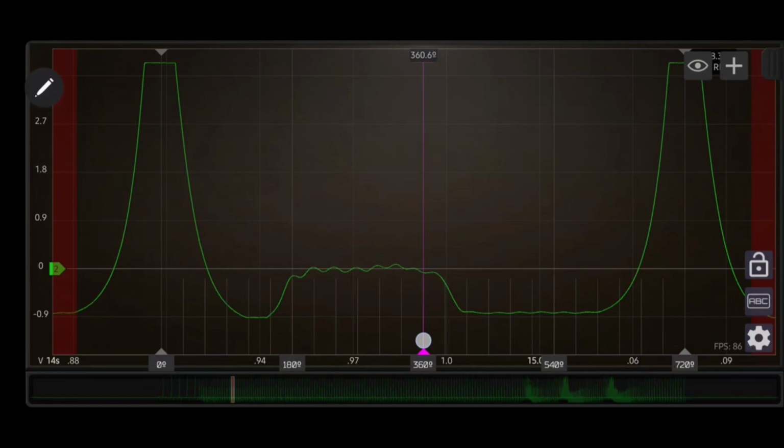And that is further confirmed by the fact that you want this waveform right here, this downward strike right here, to be closed by like 45 to 60 degrees max, this slant right here. Now you can see that it is closed by 60 degrees. However, you want the 20 to 30 degree mark, which this is 30, so you want it back here somewhere to be in the center of this falling slant right here, this slope.